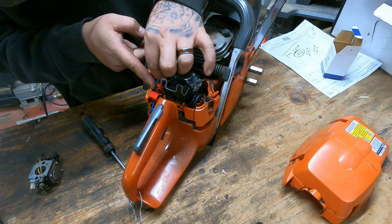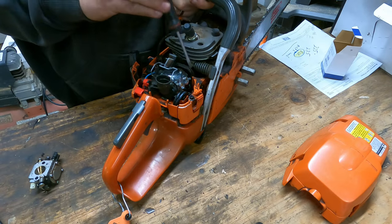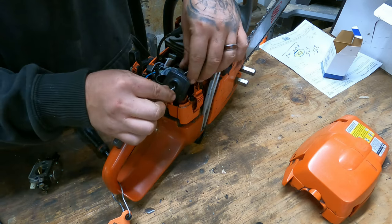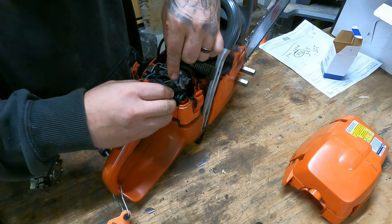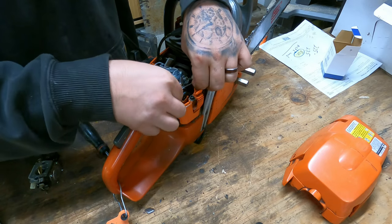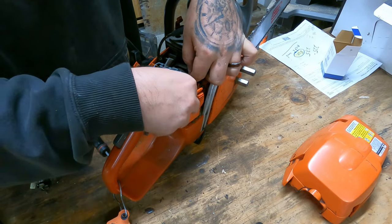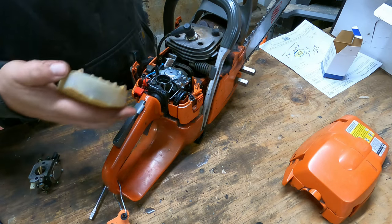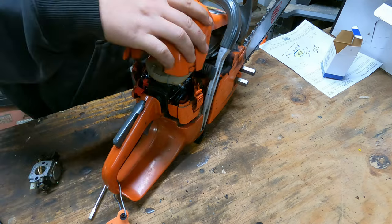After a bit of fumbling, got it in there. On the new carb, the little wire latch that holds the throttle rod down is always in the locked position, so just flick it out to unlock it. I like to put the throttle rod into the handle first and then move it down into position to latch the butterfly. Hold the throttle flap all the way open with your finger, slide the rod in and release it — it will automatically lock. Push that little spring back down, put the filter back on and the cover back on, and you're good to go.